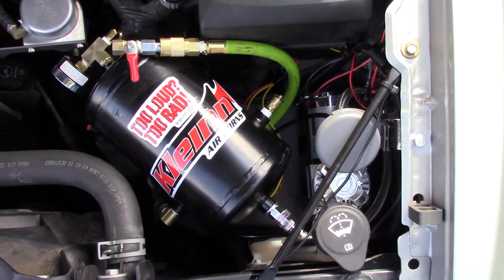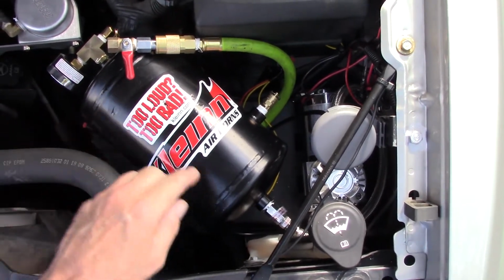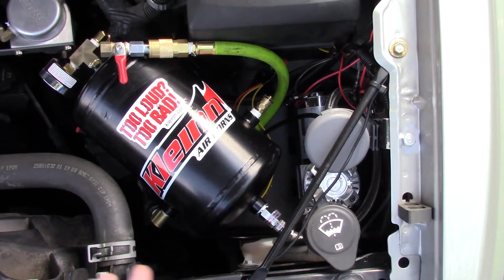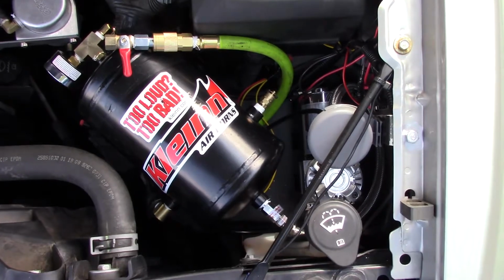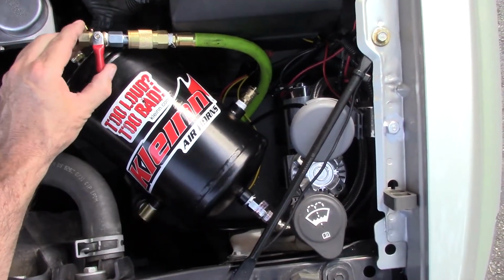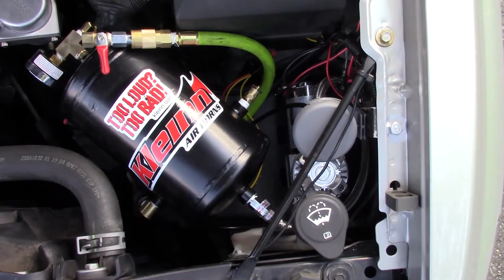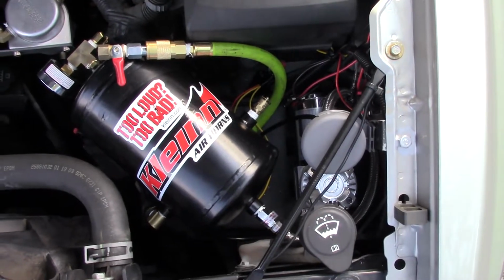On the tray they give you, you bolt the air tank in and the compressor. You bolt that in first, get everything assembled, and it slides right into the spare battery tray. Now on this one here, I did add an air hose to it and a nice ball shutoff. I prefer that better. And when I want to drain the tank of air, I can simply reach this and turn the valve, and then it bleeds the air.